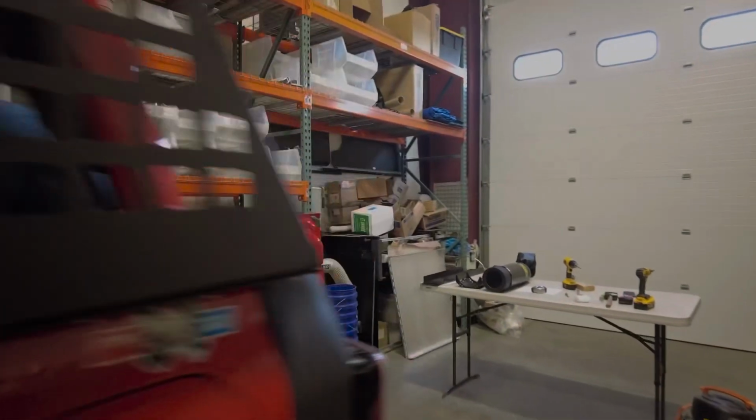And I still like to leave everything all the way loose until you get the top panel on. Yes, that means you're going to have to lay in the back end to tighten it all up, but this way you know that all your bolts will line up easier. So as soon as I get this last one on, we'll show you a couple other little items.